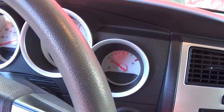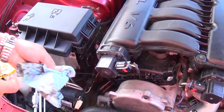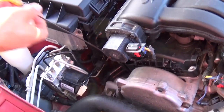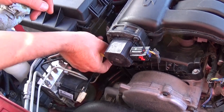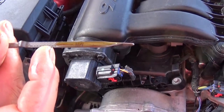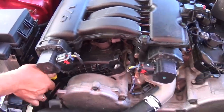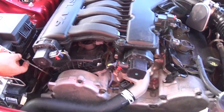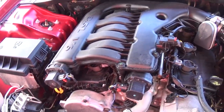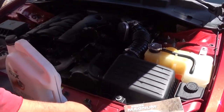After running the engine, pull the dipstick and wipe it again — the first reading won't be accurate since oil sprays on it. Reinsert it, pull it out, and check the second reading. Right now it's right at minimum, so you can add a little more to bring it between the minimum and maximum marks. With exactly 6 quarts you'll be barely above minimum, so you may want to use about 6.2 to 6.3 quarts. That's the whole procedure — thanks for watching, don't forget to subscribe and give us a like. We have a new video on our channel every day.